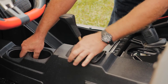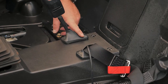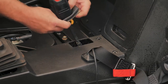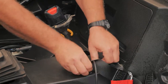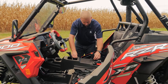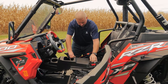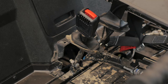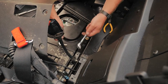That gives you the opportunity to raise the console up. You also want to go ahead and remove the boots for the buckle and the other Click 6 harness — just slide those up to get them out of the way. Lift the console up and start feeding the boots down through so you can get it up and out of the way. Now you can access the buckle, so go ahead and remove it.